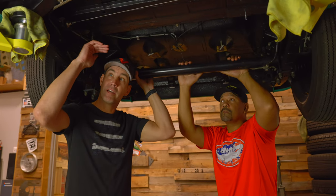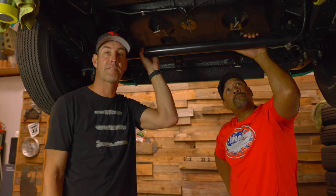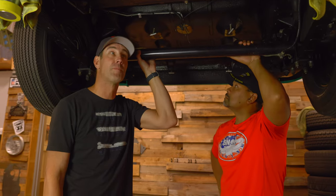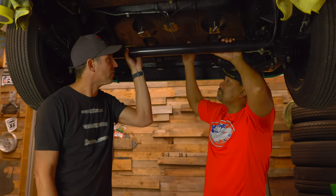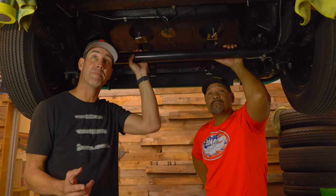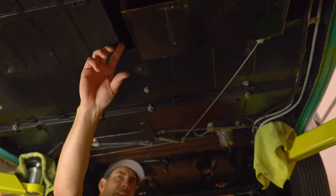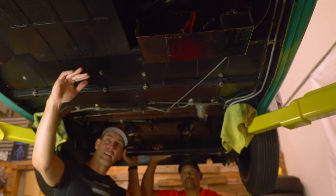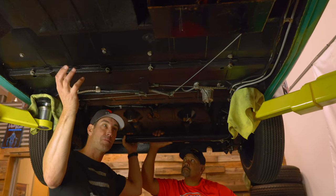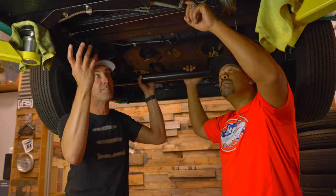The bottom of this car is fairly flat — I put a straight edge on it and basically we have a nice plane going all the way across. We are going to be using Tesla batteries — 14 modules in this car. It doesn't need all 16; this is not going to be a crazy hot rod. The gas tank is missing and we don't have a rear differential, which means there's no tunnel in this car and no driveline. So we have all this area back here to put a battery pack underneath. We're going to tuck in a battery pack that bolts to the bottom of the car, protected with really thick aluminum with a bash guard up front.